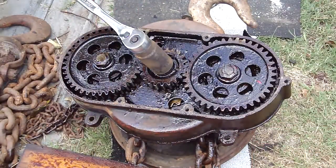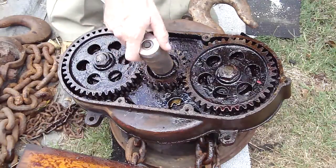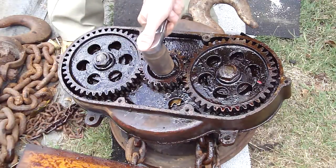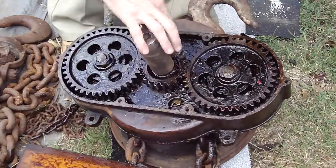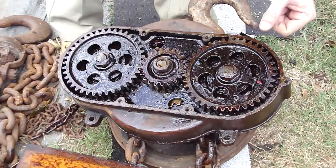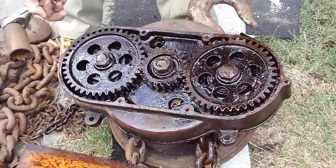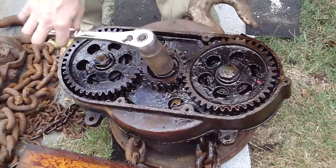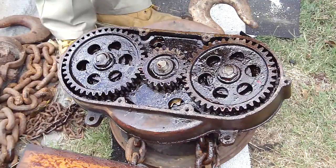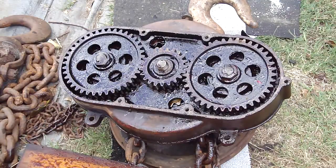I've got the castle nut off — it's all the way off. Found a socket, it's not SAE, it's 32mm, but it fits tightly enough. I just barely had to use the breaker bar to knock this one loose. When I watched the video of me shaking this earlier — the video's a good tool — I could see it was this gear that was holding it down and not these two. So I'll take the nut off, take the gear out, and I should be able to pull this end of the case off.